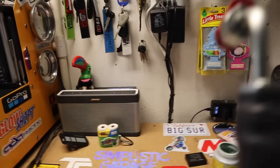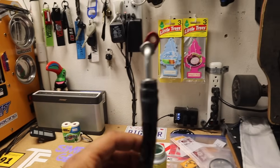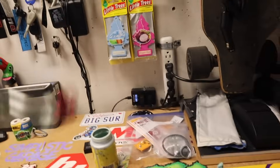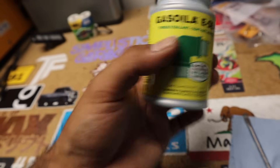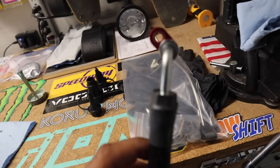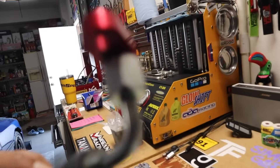Back at the bench — a good trick is to look at the fitting like a clock. I can see this fitting is pointing toward about one o'clock. So when assembling, you remember that looking at it dead straight, it should be at one o'clock. The other side is pointing toward around ten or eleven o'clock — might be a weird way to think about it but it works every time. Now I'm going to remove it, put a dab of thread paste on the threads, and tighten it in the vice grips. Remember, before tightening in the vice, you want it pre-positioned at the clock position so when you tighten it, it doesn't move and you get the most accurate install.